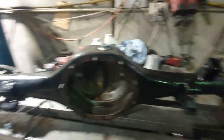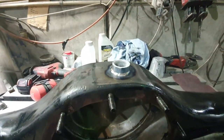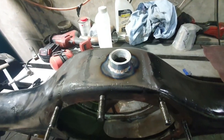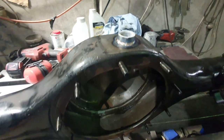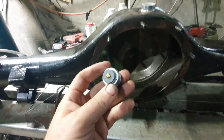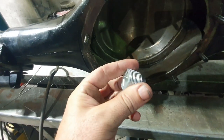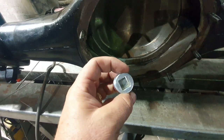I got the whole entire housing out of the car. That was easy enough, because it was pretty much totally disassembled. I've cleaned all the inside of it out — that was a bit of a job too. I drilled a monstrous hole in the top of it and welded in this little drain bung. These are a Nissan drain bung for Patrols and Navaras. I really should get the part number — they're such a great little unit and they're not really expensive.